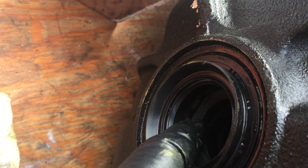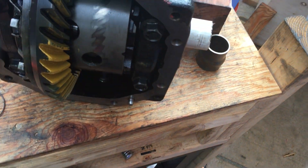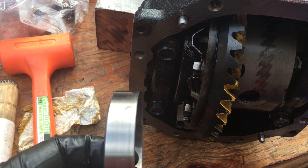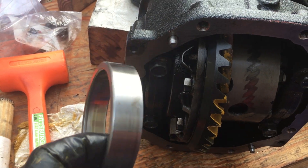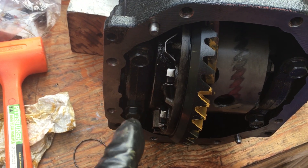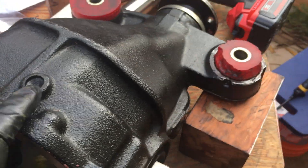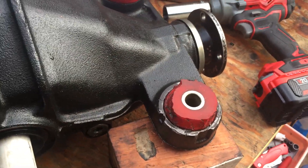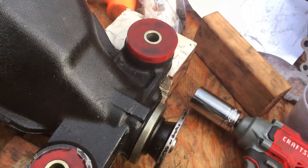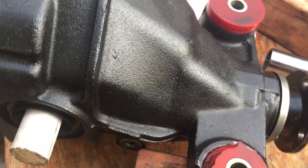When taking this apart for an internal cleanup or mod, absolutely mark the race that came off as to whether it was the left or right side, and mark the washer as well. I even marked the washer as 'outside,' so I put LO and RO on mine. Bear in mind those are just a small part of how you manage your backlash.